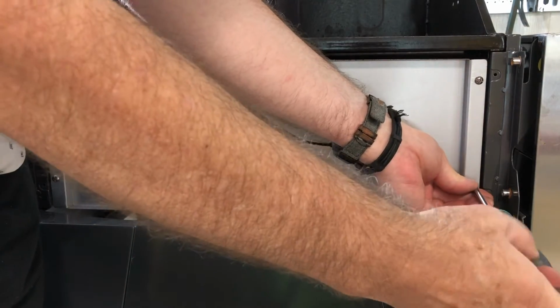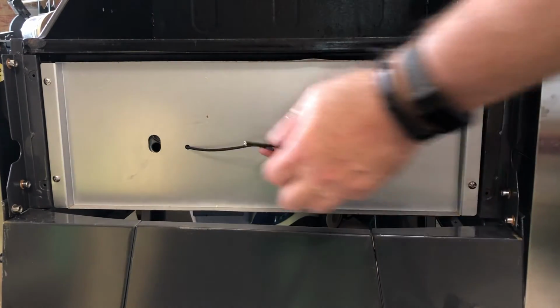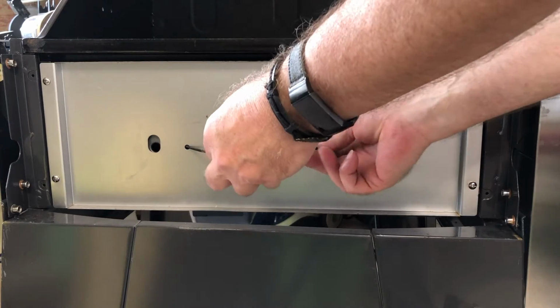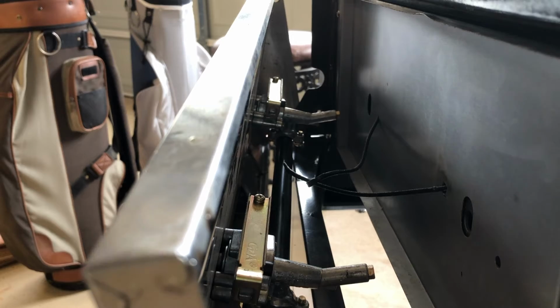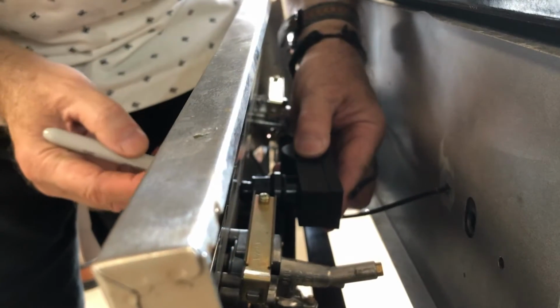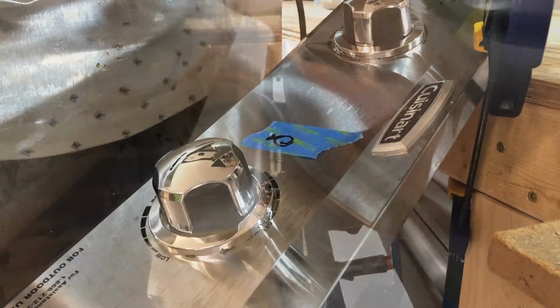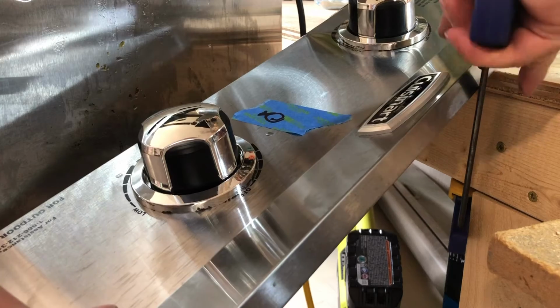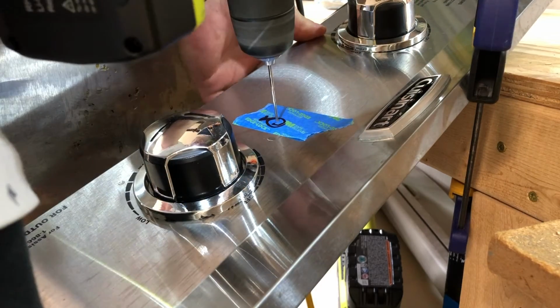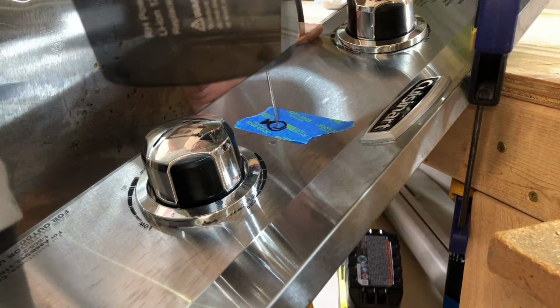Just get that last screw in there. And another tip, put the screw on the screwdriver before you start it. It's a lot easier that way. So, okay, just checking that. You can see now they go to a central location. Now I need to look at this igniter, where it fits, make sure that the wires will go to the little ports where it plugs in. You saw those earlier. And then the piping, you got to make sure that you don't drill a hole in a place where you can't later install this igniter because of the piping.